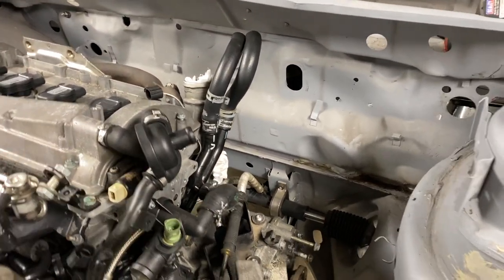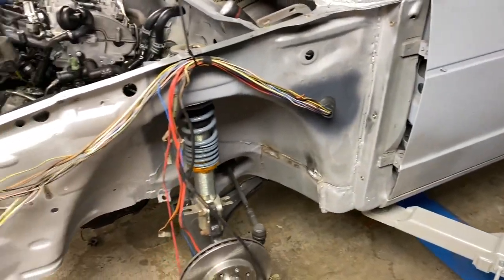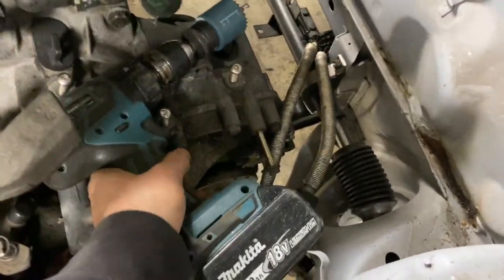So I'm going to bang the same size hole saw, or the right size hole saw for that one through, which I believe I've put down somewhere. I'm going to make sure I pick the right one up, and it is a 44. So the holes in the bulkhead from the original wiring loom are 45. I've got 44. It fits, it does what it needs to do. So let's get that hole drilled, get this wiring in, chuck the ECU in the car or the plugs for that. I've taken the gear linkage and everything off the top of the gearbox and get in with the drill.